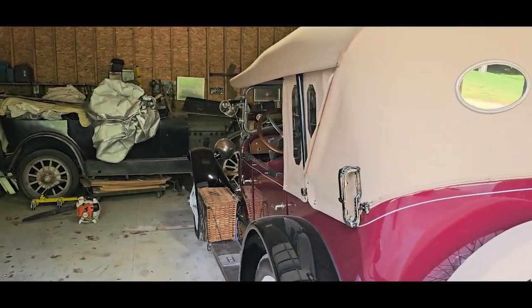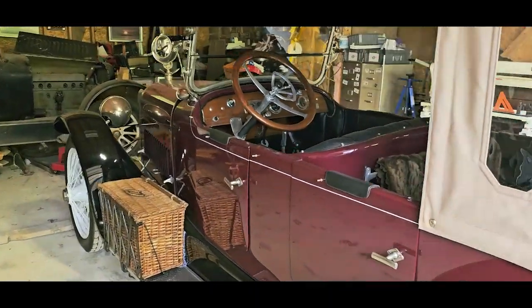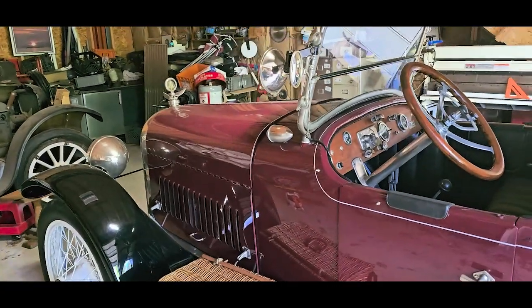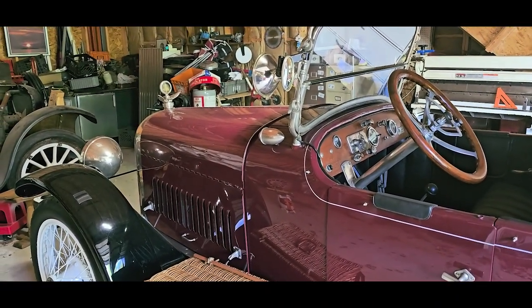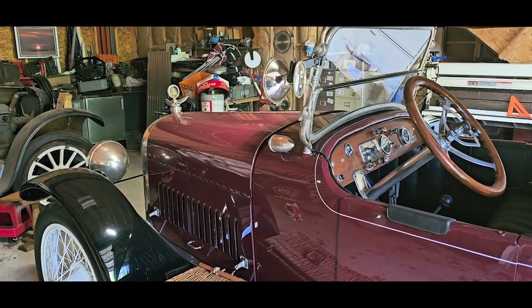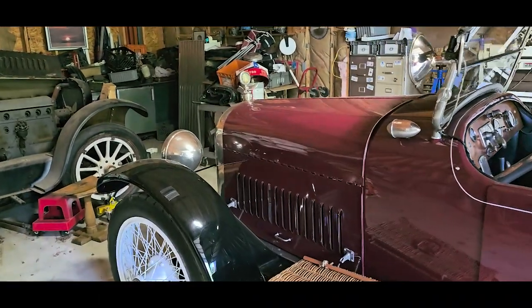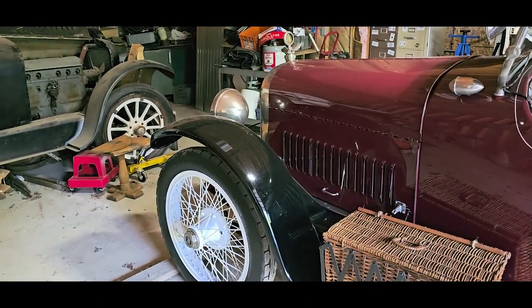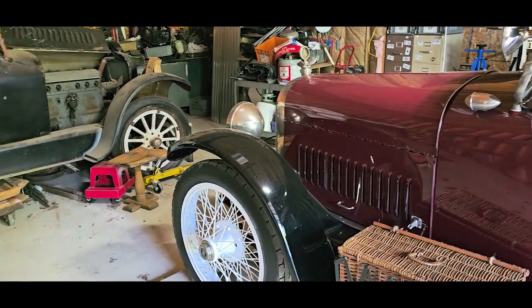It's time I pulled the beauty out of the trailer. Before I did, I checked the radiator fluid level — and I knew eventually this block was going to let go, as it's all held together with epoxy. Radiator fluid was nowhere to be found, and it wasn't on the ground in the trailer. I put a pan on the floor, popped the drain plug out of the oil pan, and that's where all the radiator fluid was.